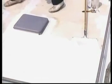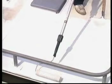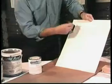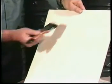If you're spreading liquid roof too thin, it will drag on the brush or roller and will either not self-level or require more than 10 minutes to level. If too thick, liquid roof offers little spreading resistance and the surface levels in about 1 minute. You have the right thickness when it's comfortable to spread with slow brush or roller strokes and takes 3 to 5 minutes to level. When applying liquid roof to sloped, rounded, or vertical surfaces, it is important to achieve an even wet film to avoid runs and sags.